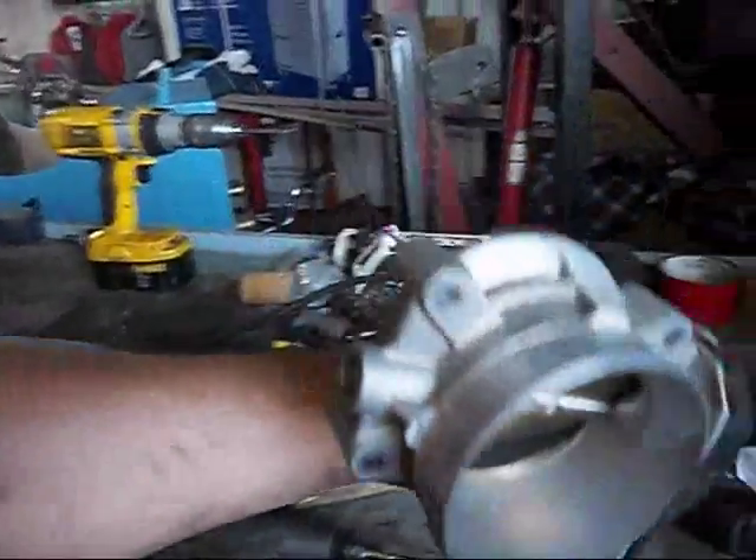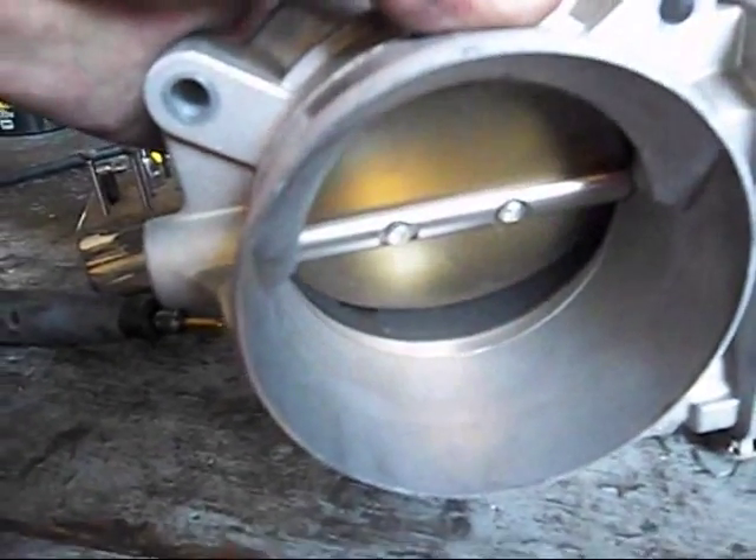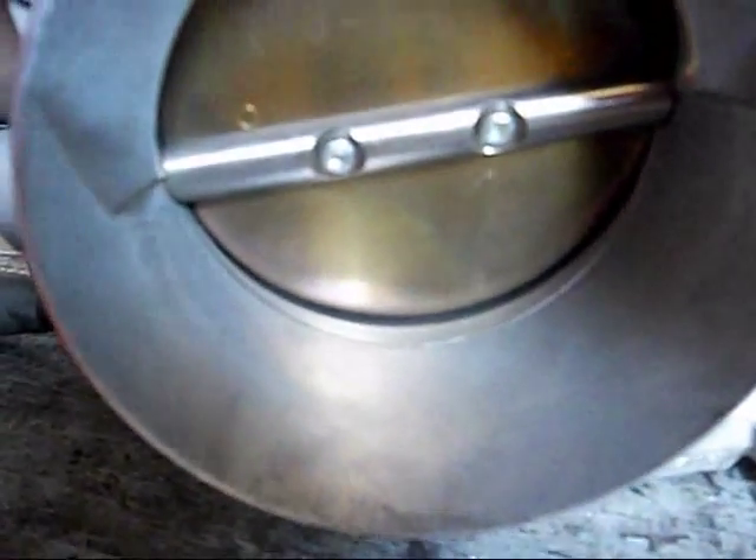But if you look down here, this is how you tell where to put the groove. If you see that black line right there — you can see it — that is the exhaust gases. That marks the natural idle position. What we're going to do is slide that throttle plate close and wedge it somewhere like that, just where a little bit of the black line is showing, and that's where we're going to cut the groove.